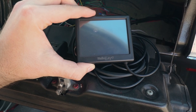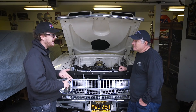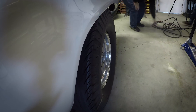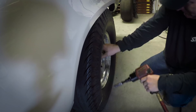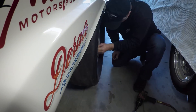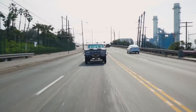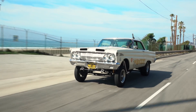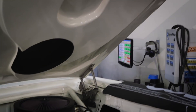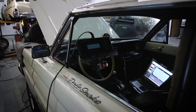What we'll do is put it down on the dyno first and see what the self-learning has done on its own. We'll show you basically how much you can maximize this with the stock kit. Note: tire manufacturers do not prefer you to run any kind of racing tire on a dyno roller because of the shape of it, so they prefer if you have to do it to run a radial tire. We're here at West Tech Performance, just got it warmed up, and we're about to do runs in stages — out of the box, with tuning on the base kit, and then with the distributor.